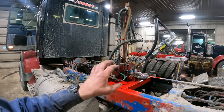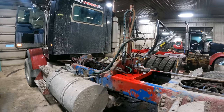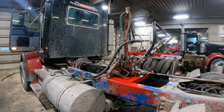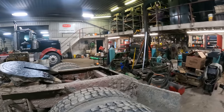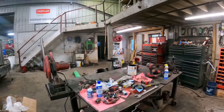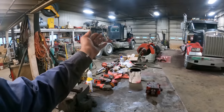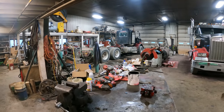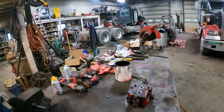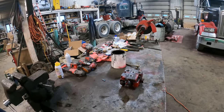So I got a hold of this one place, trusted them, and bought I don't know how many valve systems — truck 14, truck 15, the Freightliner, this truck here. Maybe five or six systems. This was the valve unit I was going with. I said, maybe that's the next best thing — this technology here is maybe 20 years newer. Freaking garbage. I don't know if it was earlier in this video or the prior one, but this is where the handle goes on. You'd have a handle here like that — we've got this rubber boot, we've got a spring inside here. Moisture would get inside, this would fill up with dirt, and the tolerances were so tight that once it filled up with dirt and grease and grime, this valve wouldn't stroke fully in one direction or the other. What we did — and I didn't do it on this one because it was mounted sideways — was drill a hole in the bottom of this little aluminum housing just so any condensation or water could drain out.